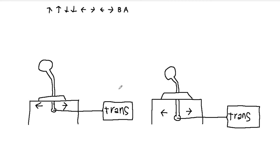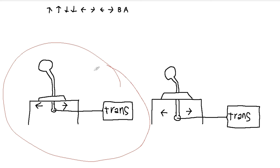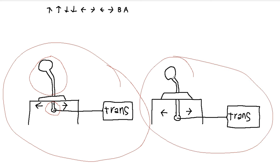So here's how you fix that. This shifter over here represents our stock shifter — long shifting rod and a short actuating rod. You have to move this a long ways to get this to move only a little bit to shift the transmission. Whereas on this side, we have our short shifter. This rod is short, this rod is long, so you don't have to move this very far to get this to move a long distance to shift the transmission.